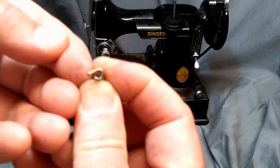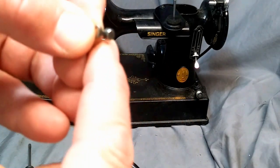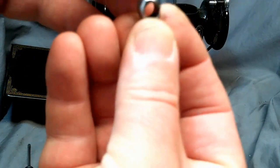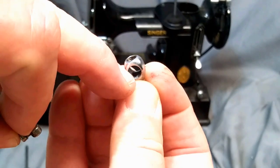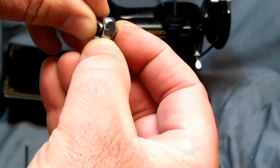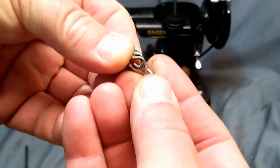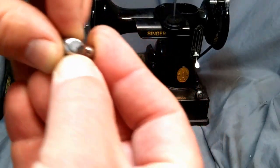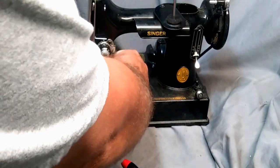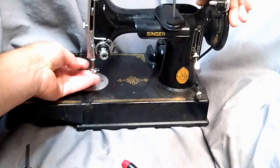You have your lower thread guide, and when you look at it underneath it should have a loop to it. That little round area that sticks out on the end of the loop — that's what fits inside your needle clamp. So when you're holding the body towards you, it goes in and slides into the little slot inside. Now you have to try to hold your needle together like this and then slide it up on your needle bar.